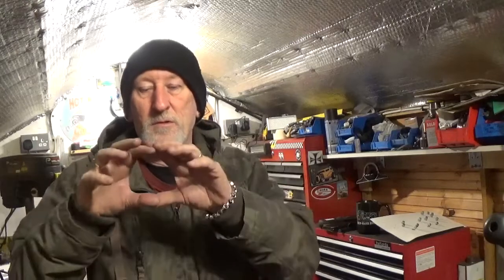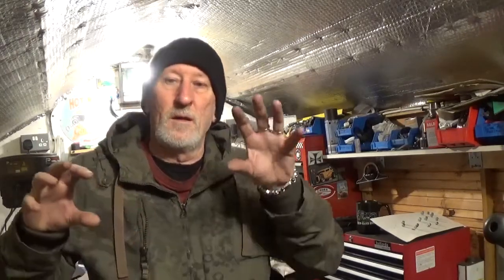Now some people may ask why I'm cutting the cam cover down. The reason is I like the finned covers — I think it looks old school. I love finned covers; anything I can get I'll have a finned cover. But just putting a finned cover over the top of the cam case doesn't look right, because you've got the extra metal hanging about. So I'm going to cut the cover down to the size of the finned cover, and then the sprocket cover is another little finned cap cover that goes over the top. It looks like two separate units, which I think looks more old school. That side cover is definitely Sportster — not that I'm trying to get away from the Sportster. I love the Sportster engine; it's a fantastic little compact unit and it's quite light.